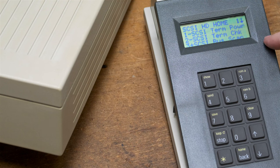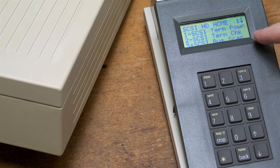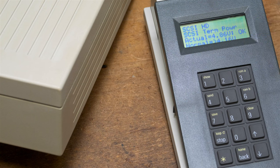At the main screen we can see it's checking SCSI termination power and SCSI termination check. We can actually do that - it's just a very fast check. It says it passed because it's terminated. If we go back, we can do number one, SCSI termination power, and it tells you the voltage level there - actual 4.86 volts. Normal is 4.16, but 4.86 is just fine. I recapped this particular power supply, so that may be why it's a little higher than normal, but anyway it says okay, meaning it's within range.